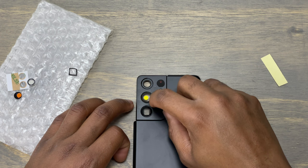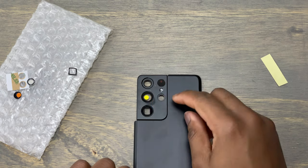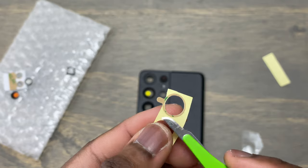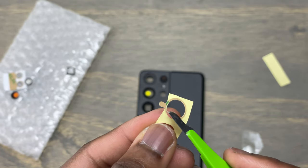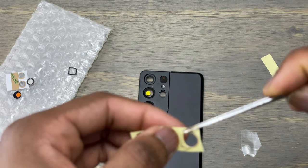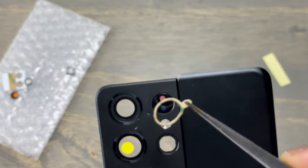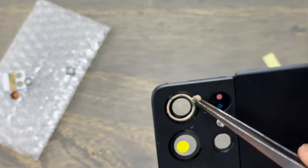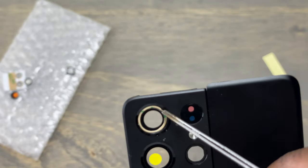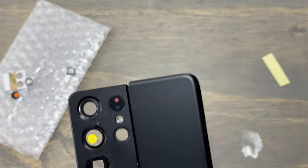It is time to install the second lens. The yellow dot should be facing you. Apply some light pressure for the lens to stick to the back cover. I had some trouble with the third double-sided tape and I used my blade to remove it — it was the only way to safely remove it because there is no exact replacement. After you successfully removed it, install the double-sided tape inside the lens hole. Apply some light pressure on the double-sided tape and start installing the third lens.